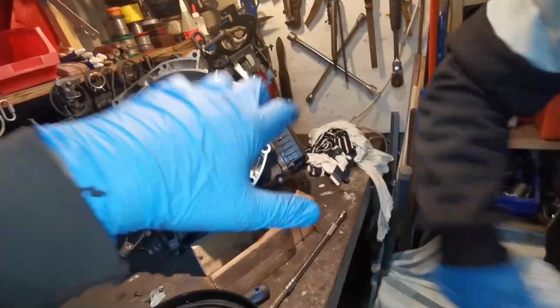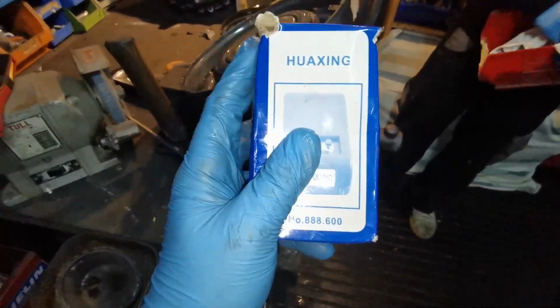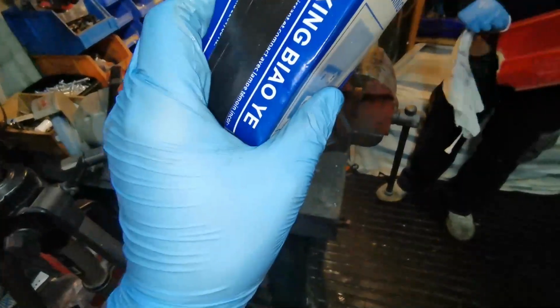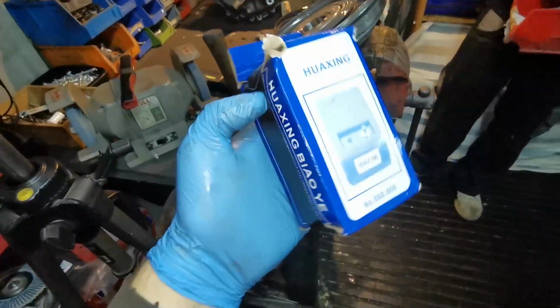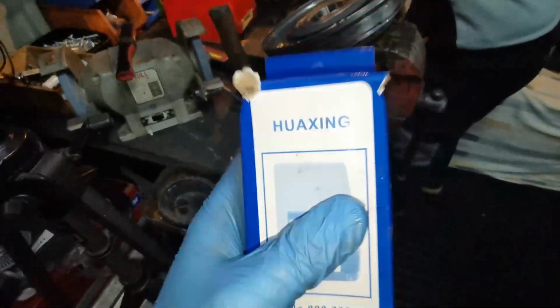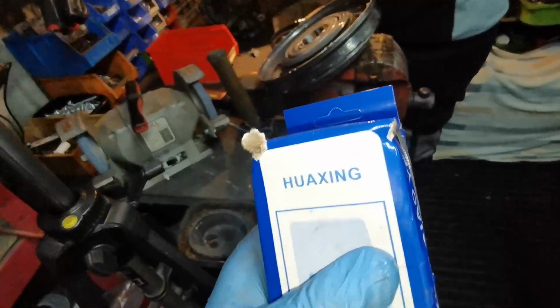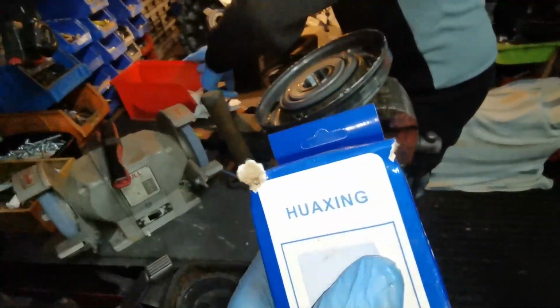Later on we'll take the mechatronic part off the unit and take that apart. That needs deep cleaning. Obviously I've got a little box that makes the magnetic stuff not magnetic anymore. A demagnetizer. I'll show you that later on, but basically you put each solenoid on it, you press the little button and it's not magnetic anymore, so that you can clean off the little filings, basically the dust, the gearbox leftovers, the little metal filings that get stuck inside the solenoid.